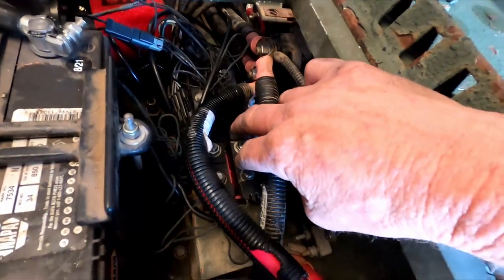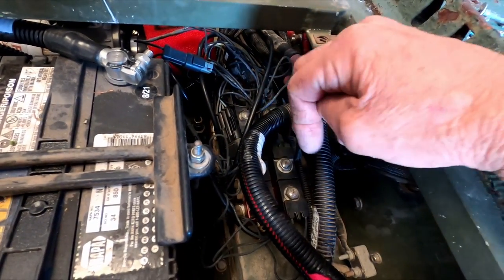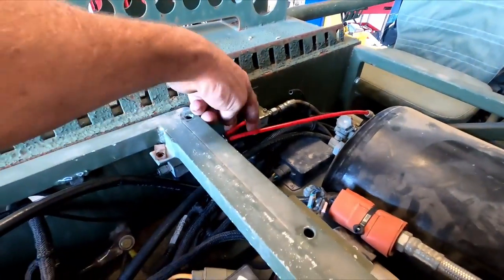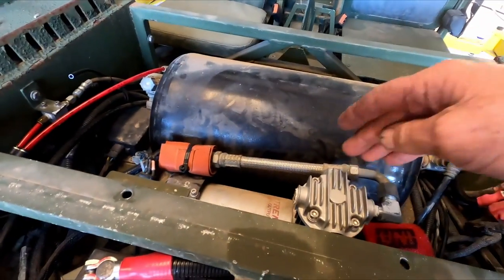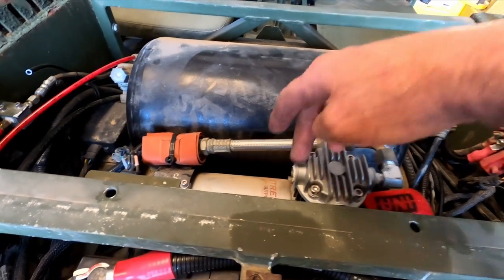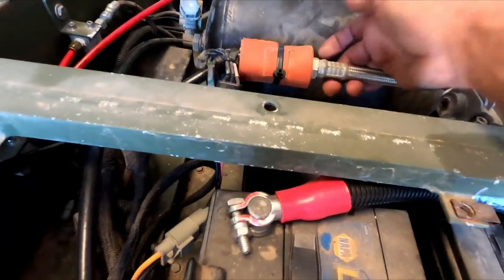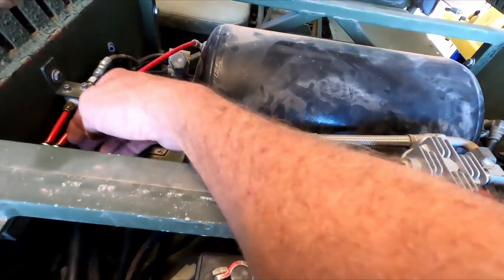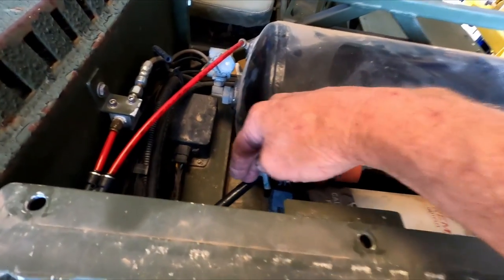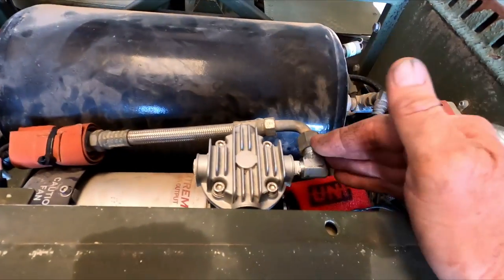Down here, when I was talking earlier about the suspension issues, these solenoid valves were giving me all kinds of problems. First off, I had a lot of leaks in here. You can see all the red hoses I changed. There's fittings I changed. This here, for some reason, they hooked the air compressor outlet on this side. So this was over here, and it was so tight over here because of this stainless steel nylon hose. When we checked it out, it was kinking the tube here. It was smashed up against here, rubbing on everything. So I moved it back to where it goes.